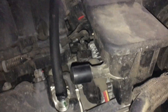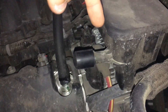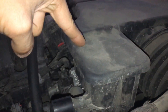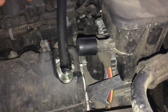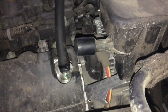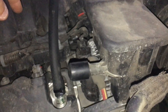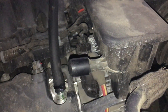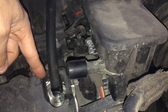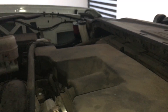Next, on top of the cylinder heads there is a hose that connects the cylinder head to the intake box on the throttle body. It feeds gases from the crankcase ventilation into the clean part of the airbox. I capped that side so no air goes in, and on the other side it vents the vapors directly to the catch can.